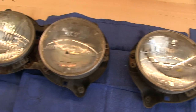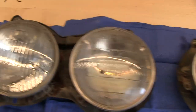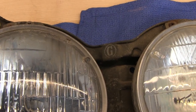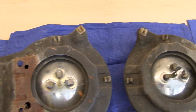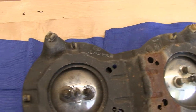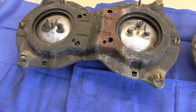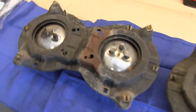It's time to pretty up the headlamps and headlamp buckets. There's a left and a right, and there are original markings on them — clearly marked left and right. I hesitate to sandblast these and remove those original markings, but that's what I've got to do to make them pretty. There's some rust here. We'll blast that out and protect it with a new layer of powder coat.